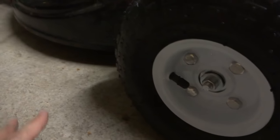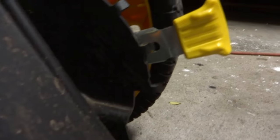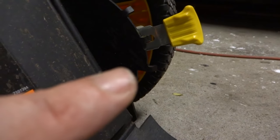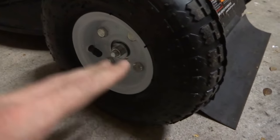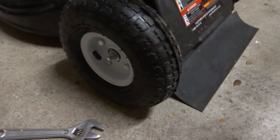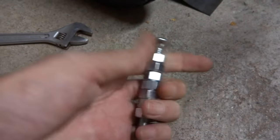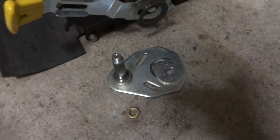It's at the perfect height. I like my grass cut kind of low, so I had this on the second from the bottom — there's one, two, and that's where it's going to be with this wheel. I'm putting 30 pounds of pressure in it so it's got nice wheels on there, looks real good. I'm gonna take the other side off and show you the parts I used and how it worked out using these nuts to take up the gap.